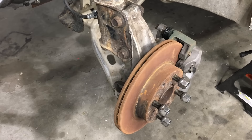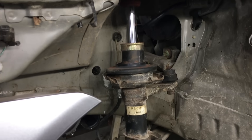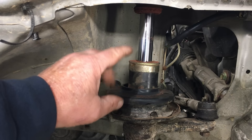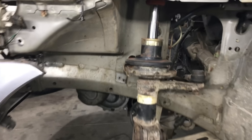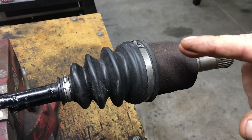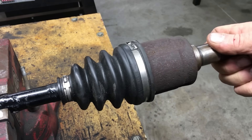The first thing we need to do is determine how long the axle needs to be, and that's also going to be tricky. In order to find out how long the axle should be, we had to remove the spring from the suspension strut, and without the spring we were free to move the suspension up and down. The reason we wanted to move the suspension is that the length of the axle actually changes depending on how much the suspension moves — it's the job of the inner tripod joint to vary the length of the axle.